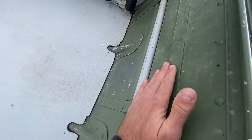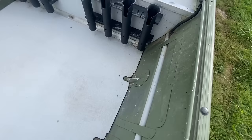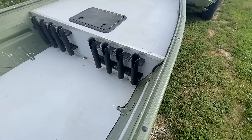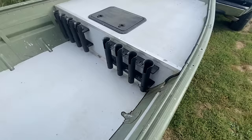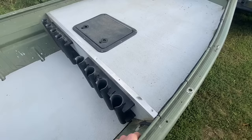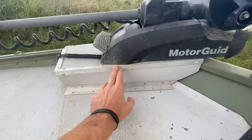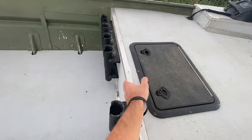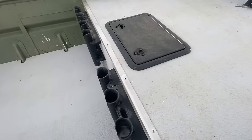After painting it, that was probably one of the best things I've done on this build — getting rid of that bench. I was worried it would make the boat kind of flimsy side to side, since that's a big part of the support in a jon boat, but it didn't make any difference at all. You can't push in on the side at all. I think a lot of that is because I have a two-by-four going across right where the bench was, which added the strength back. I also trimmed a lot of this stuff with light-gauge aluminum angle to clean it up and protect the edges of the plywood, and I just riveted that on straight into the wood.